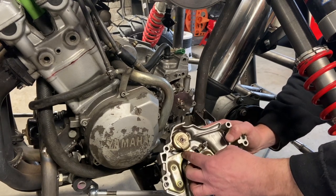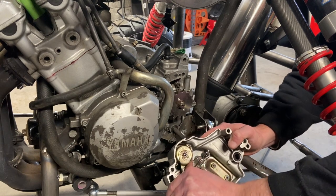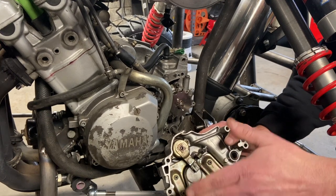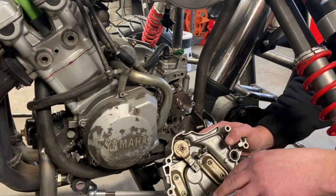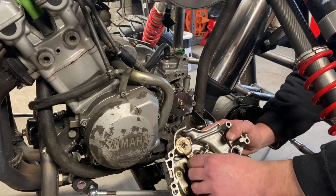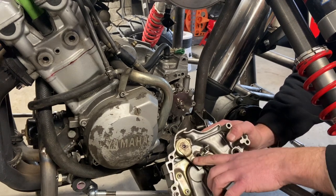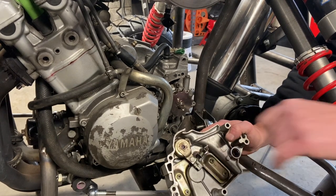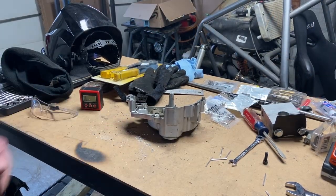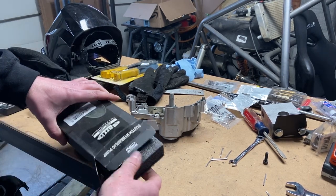We have fully engaged with no pressure on the system, all the way up to however you want your pedal to feel. If you release your pedal and want instant grip with your clutch, you can set that. If you want a little midpoint, you can set that too — just be careful not to overstroke your clutch. I'm giving away a lot of my secrets, but I don't care because I want builders to be able to build this and enjoy it.